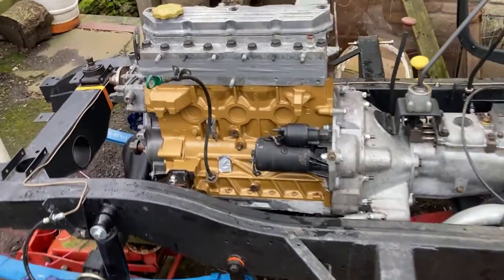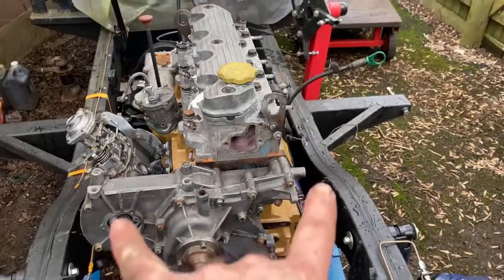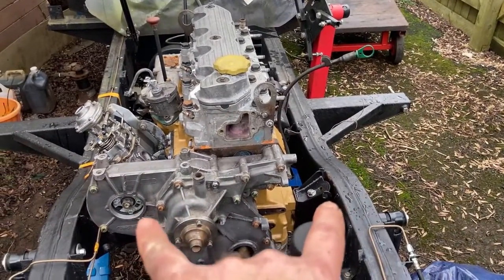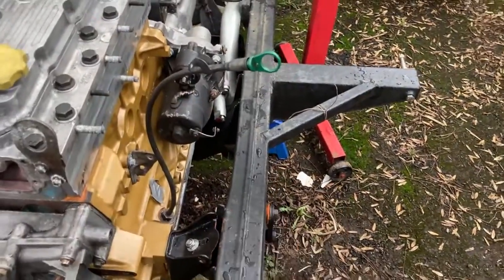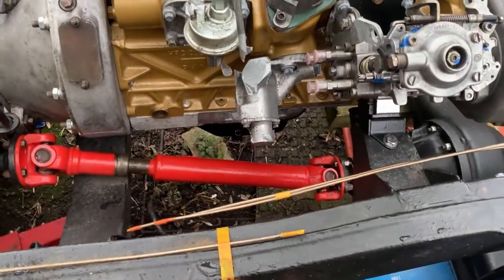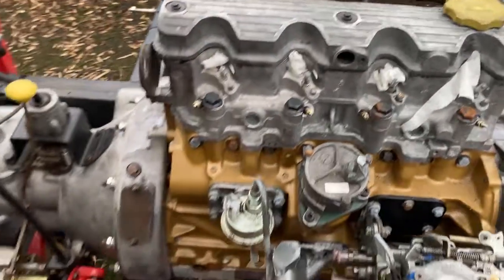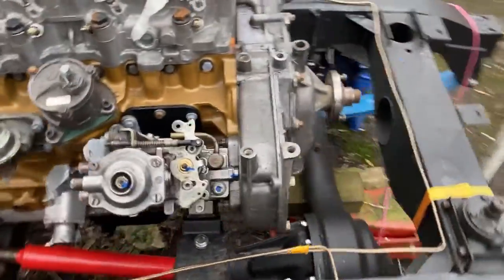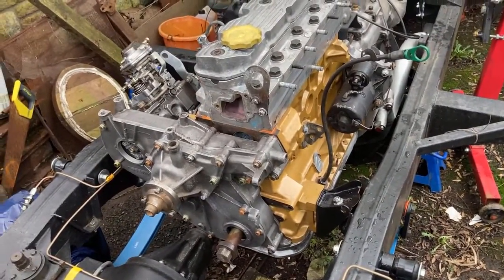Well, just to sum up, the wrestling match was basically elongating or stretching these holes, the mount. You can see we come this way to get it over. As it sits, it goes to whichever side it wants to go, and what you need is slightly above, so it's central. The only thing I've not done yet is checked it parallel that way with that way, but I can't see why it would have moved, and I know that it's 10 mil higher at the mount point than original. But it's in. I've just refitted the prop shafts. Now I've got to go through and fit things like the injectors and manifolds each side and bits and pieces. But yeah, bit of a milestone. There's quite a bit to go on it yet, but it's a case of plugging the gaps into the engine and fitting on the ancillaries.